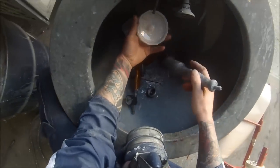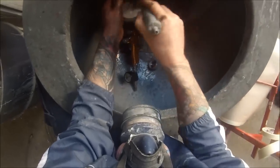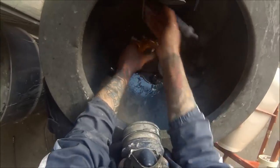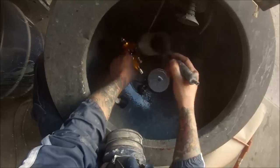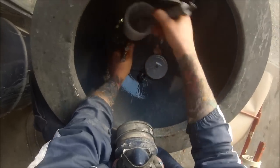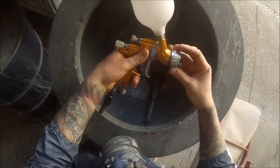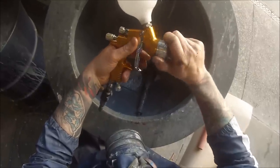I'm coming over to my gun wash machine. On the left side we've got clean thinners coming out. On the right side — for the base coat gun — it's got recycled thinners. With my clear coat gun I don't like to put any dirty or recycled thinners through it, because there can be bits of metallic that end up coming through and contaminating a solid colour with clear coat. Just brushing over it — most of the gun's pretty clean already. For an everyday clean this is about all I ever do. It only takes a couple of minutes and there's no need to pull the entire gun apart every single day.